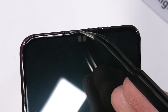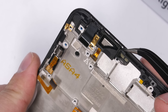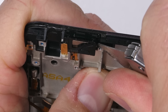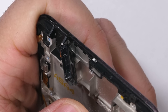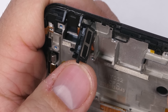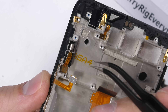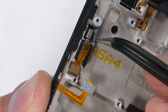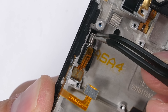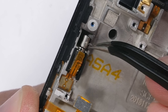This phone has a speaker grill on both the front and back sides. The ambidextrous smartphone can make calls from either screen, and the earpiece allows sound to escape from both the front and back of the speaker — pretty cool. The vibrator motor is an eccentric rotating mass motor, a bit different than the coin style or taptic vibrators we're used to seeing these days, but even though it's an older style, it still gets the job done.